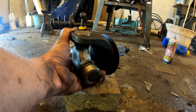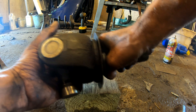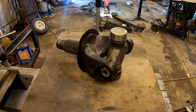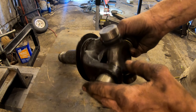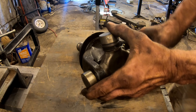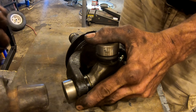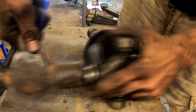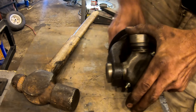It's in about as far as it needs to be for now. Just tap it one or two more times — nice and light, not tapping real hard, and it's going in easy. Now we're going to slide the other cap on from the side, splitting the difference with the universal joint — starting one cap in while still resting in the other one. Just carefully tap at a time until you get it in a little more, and then your needles aren't going to fall out and you won't ruin the universal joint.